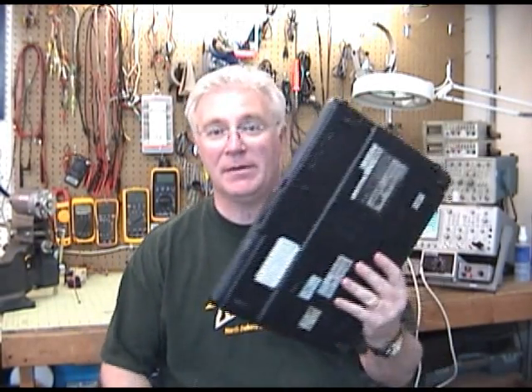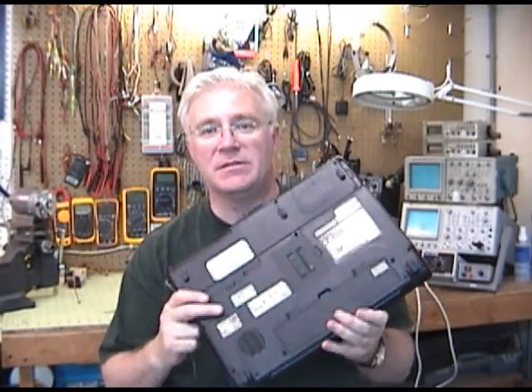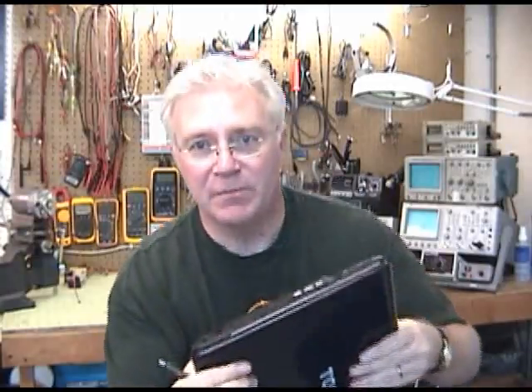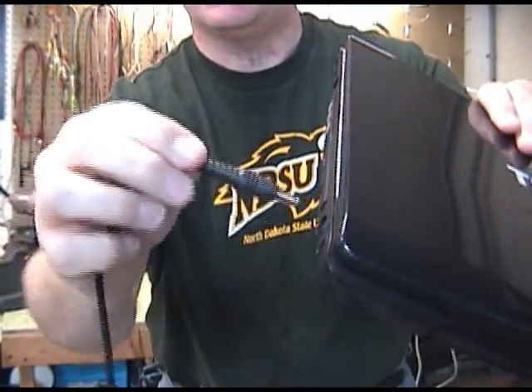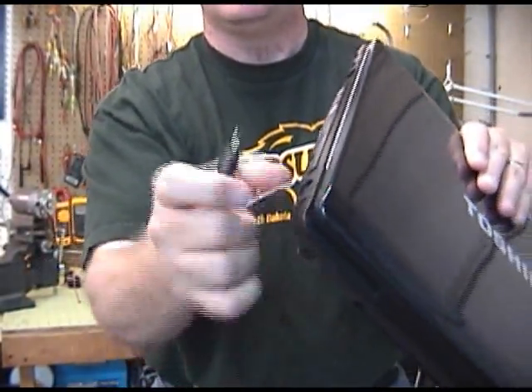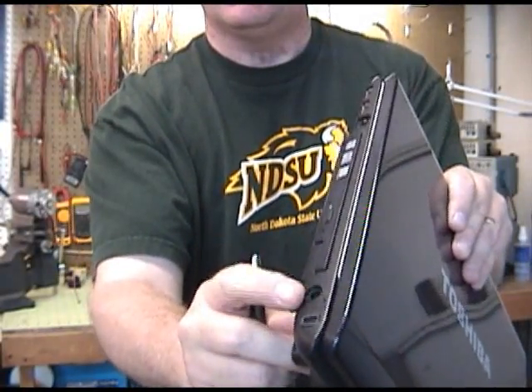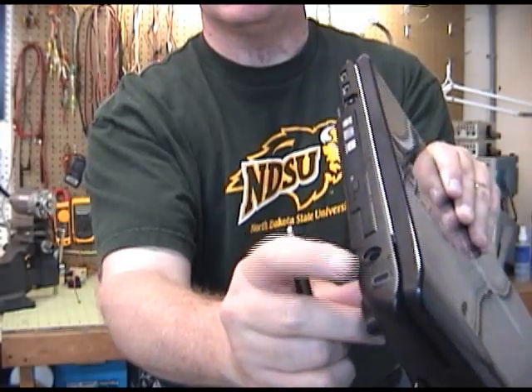What I have today is a repair of laptops. I've got a couple laptops — nothing wrong with them, there are some really nice Toshibas — but the power cord that jacks in and charges it, keeps it alive, well, a very common problem with these: people trip over them and they snap off. You've seen it on pretty much every laptop; someone comes along, breaks it off. Either the cord breaks — you can buy another one — but more commonly that female barrel jack inside will bust inside your laptop.